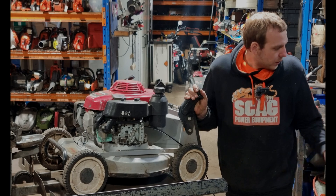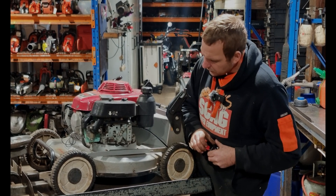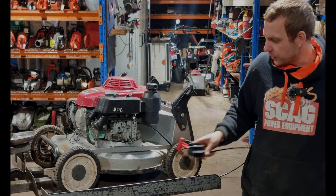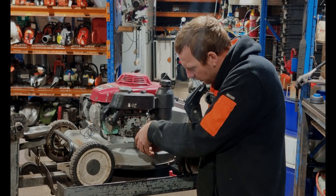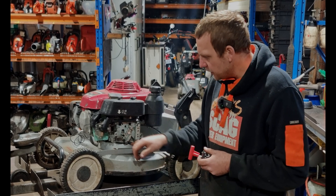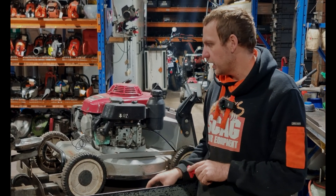Once you're happy with your RPM, I'm going to adjust the choke now. Quite often these linkages bend — it's only soft mild steel. At maximum throttle I'm still having about three or four mil play on the choke. What I can do is back my choke off, grab my pliers, go onto this tab, and bend it into the downwards position, putting a little bit more of an aggressive angle on it. Next time when I put it up into the choke position — look at that, bang, now I've got full choke. By applying small amounts of pressure to the choke tab with your pliers, the rod that engages the choke now has a lot more throw. These will just bend naturally over time too as it's only soft mild steel, but now I have full choke and my mower is going to start up first time every time.